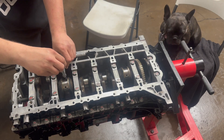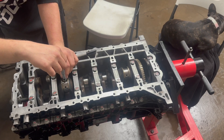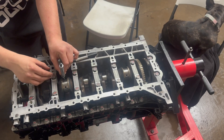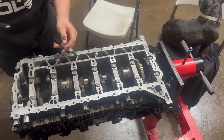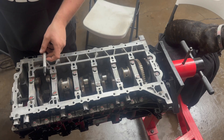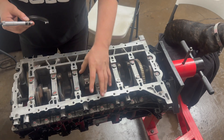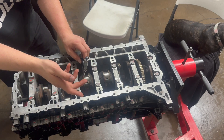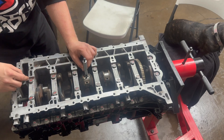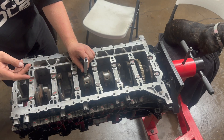I'm going to do the second one now. All right, that one's at 1.968 too. 1.968, I'll just try to remember this. That's good because that means I've got 2 thousandths clearance — 1.970 minus 1.968 is 2 thousandths, so I've got 2 thousandths clearance on these bearings. I'll look at the specs later but I'm pretty sure that sounds right.